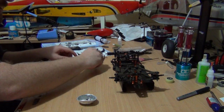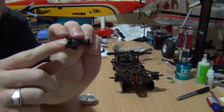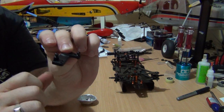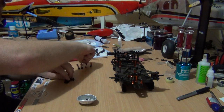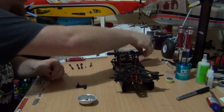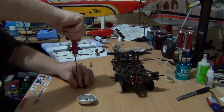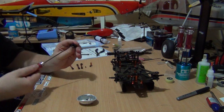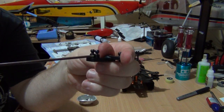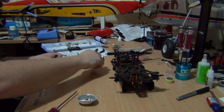So now we'll go on to the bell crank. I've done a bit of the assembly on it — there's a bearing in there, a ball stud here and a ball stud on the other part of the bell crank. This is where the steering rods connect to. Take note in the manual of where the initial setting is, and we're putting it in this hole here. Make sure you have a shim on each one so that they're at even height. Now we'll put in a bearing.